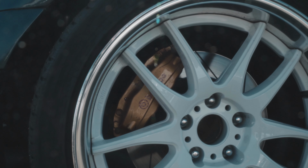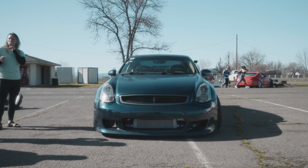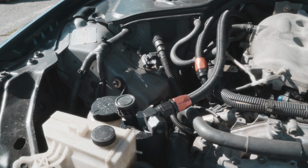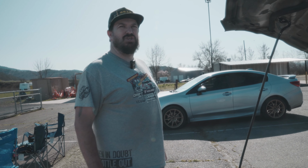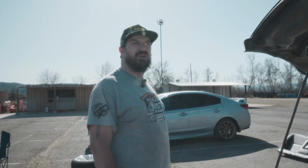Full custom suspension all the way around, GK Tech Super Lock kits, 370Z axle and hub conversions, GK Tech handbrake inside with a Wilwood master, Chase Bays system for the catch can and everything. And then I also ran a Chase Bays oil cooler up front, thermostatic. Oh, solid flywheel conversion with a stage 3 6-puck clutch. Welded diff, solid bushings all the way around.